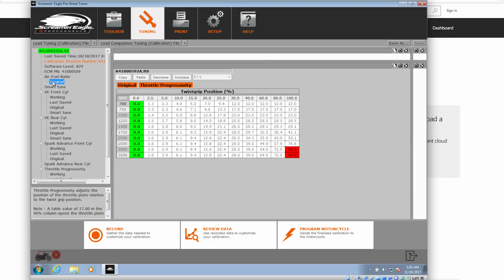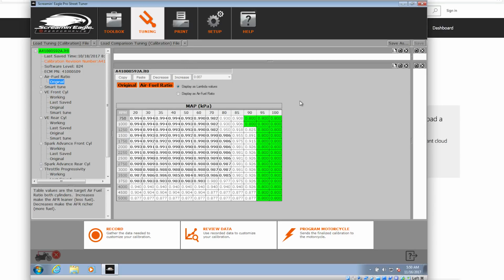Right now we are at a very light stage. There's not much equipment on my bike. I've got a cleaner and I've got pipes. No big deal. I've already loaded the Stage 1 canned tune. I rode about 100 miles on it yesterday. It ran great. There were no flat spots. I had a very minimal amount of decel popping, which, it's an open exhaust. There's no cats. The muffler is straight through.